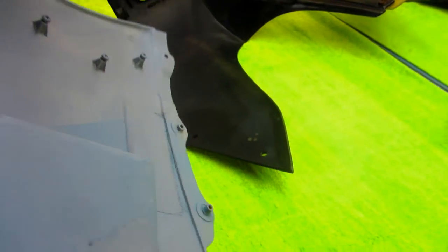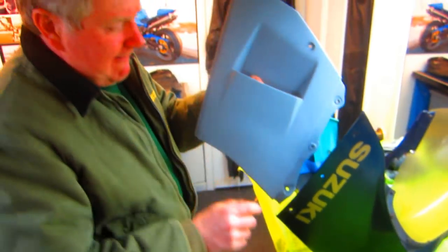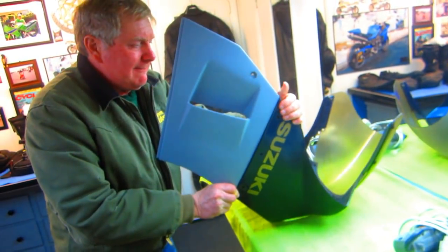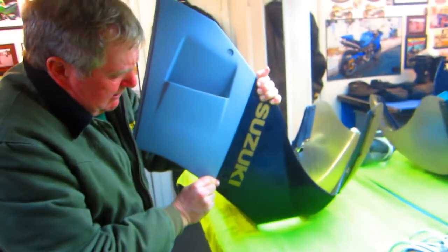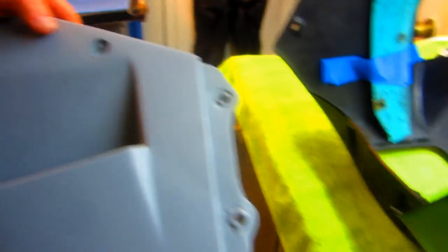Mark came over tonight and there's this divot we have to fit into. This is the repaired piece - see if it fits, start manipulating it around, flip it over and see what the joint looks like from the other side. You've got to get the joint from the other side and see if the screws line up. They're very close. How do you like the way this came out? I've got to Bondo it in a little bit - that looks fantastic. That's a piece of tubing put in and bonded around it with CA - it's solid.